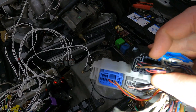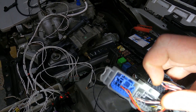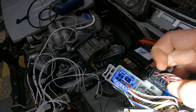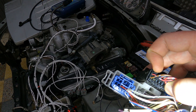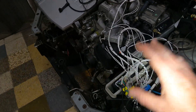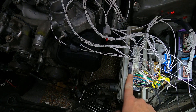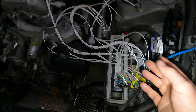Unclip it — it's got a latch running all the way across in white, you unclip it with a small screwdriver and it comes out about a millimeter or a millimeter and a half. Then you're just going to put it into the pin right next to the red and blue one — that's going to supply power for your wideband sensor. The reason we've done it this way is that all these wires come through the grommet at the bottom, and because we've used the body plugs over there, if we took power from the top of the black plug it would complicate engine harness removal.